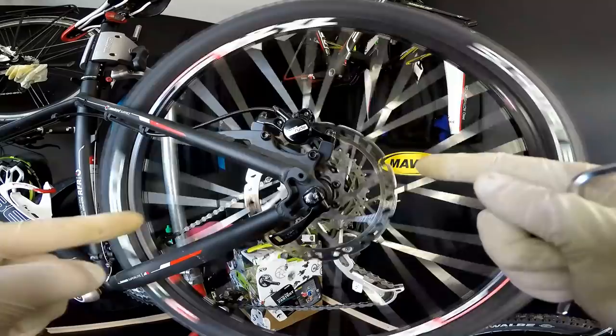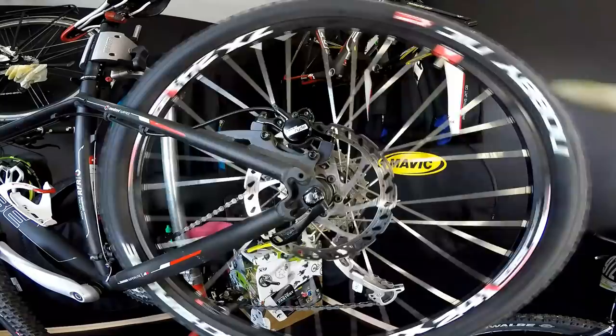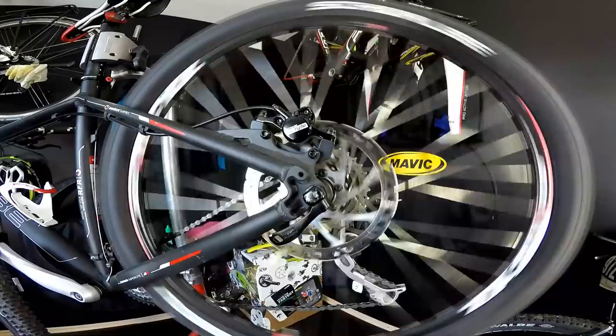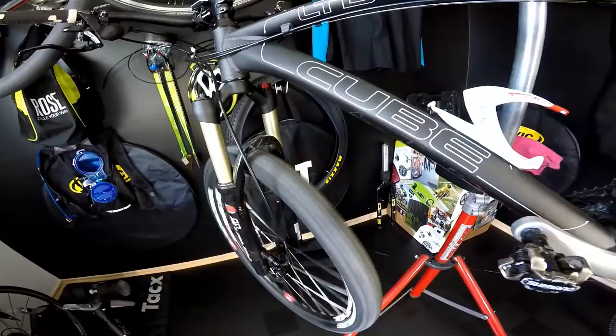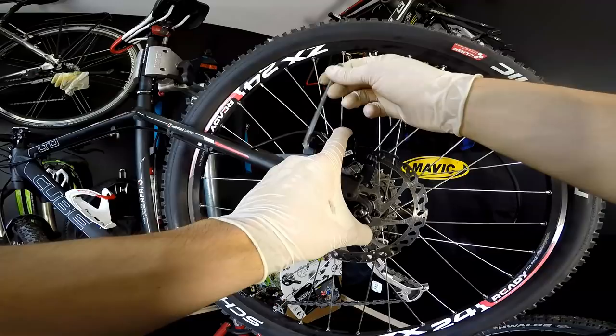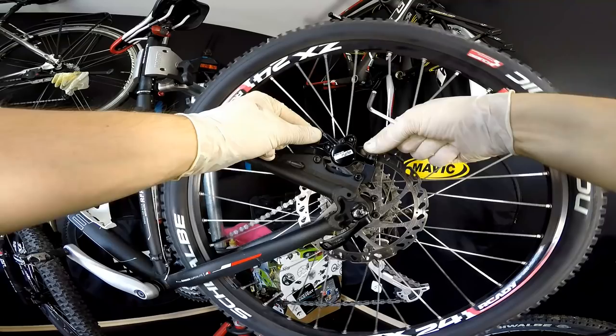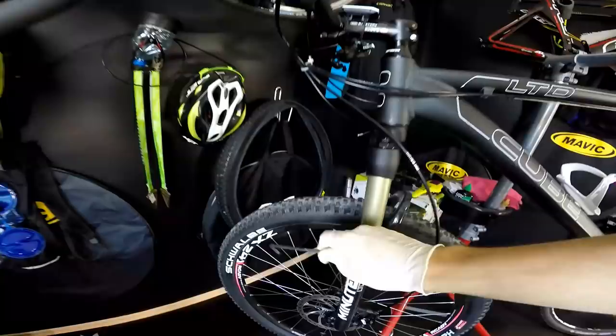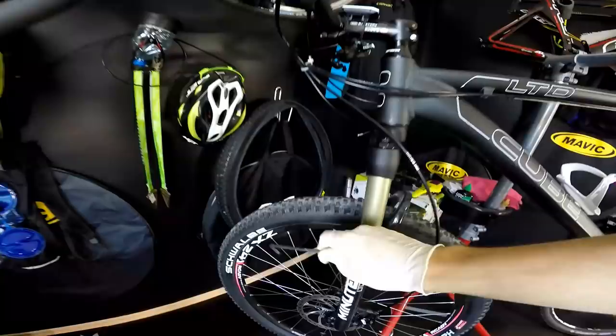I'm back because I still wasn't quite happy, but now it's just perfect — no rubbing whatsoever. Remember to brake a couple of times to see whether anything changes, as the pads can move a little. I did it also for my friend's front wheel, which is working very nicely. Remember: not only use your braking lever to center the caliper, but also try to readjust it little by little with your hands, always checking the distance between the rotor and the caliper from the back or front depending on the wheel. Let me know what tips you have for your brake models, and thanks for supporting my channel — see you soon, bye bye!